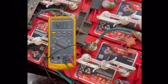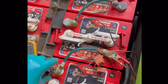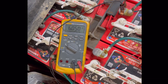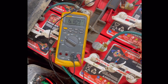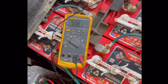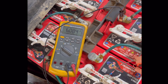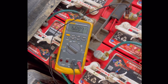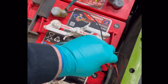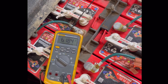Moving to the next battery — nominal six volts, so it's a little lower. Under throttle we're losing about two tenths of a volt, which is within tolerance. Anything up to about half a volt to a full volt is still marginal, but it's not dropping enough to be the culprit. Keep checking.